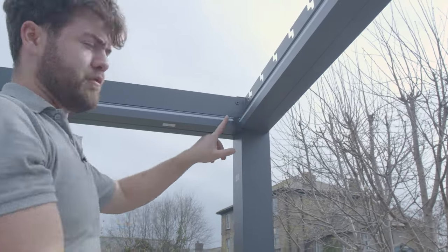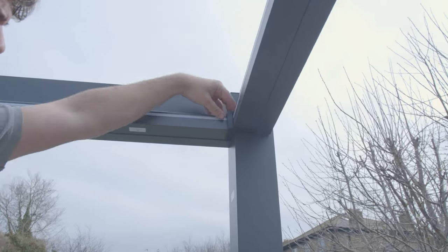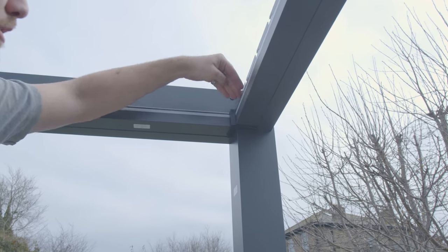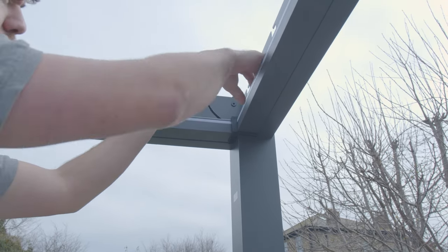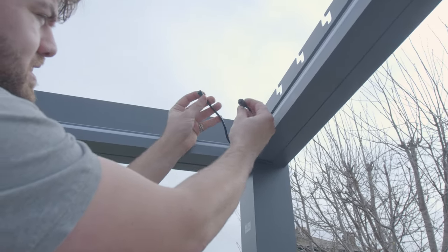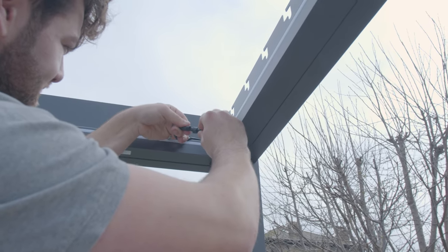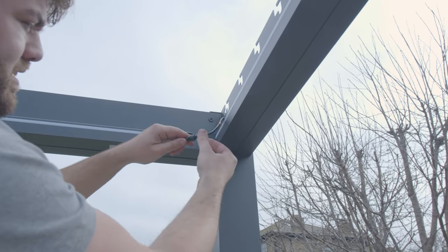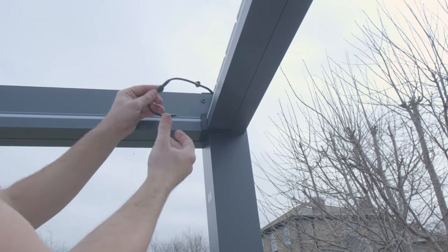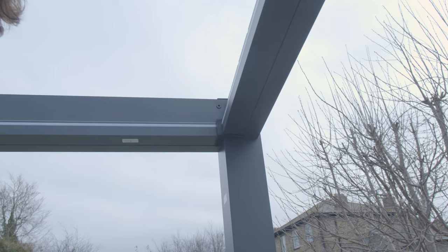Now that we've got both pieces up to this corner, what I can do is hook this over. There are these little tabs on the rubber that just lift and hook over the top just to hold the gutter down. Then you'll find a connector on either end of the light strip from each piece and they just push together — they go in in one direction, and then this piece screws on just to make it a watertight seal for the connection. At which point you can just tuck these down into the gutter out of the way.